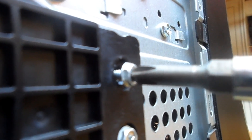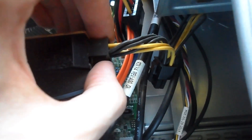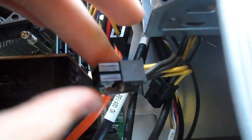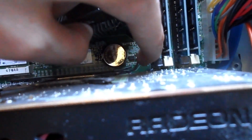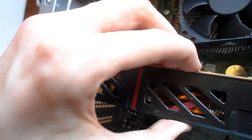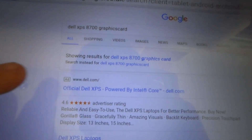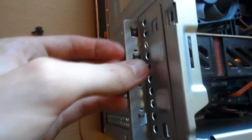Firstly, there was a little support holding the graphics card in place, so I needed to unscrew that and take that off. Then on the back, the graphics card was also held in place by a grate, so I needed to unscrew that as well. Next, I just needed to unplug the graphics card from the power supply, which proved to be a lot more difficult than I thought. Then I just needed to reach down, pull the little clip at the bottom, and pull the graphics card out. No matter how hard I tried, I could not seem to pry the graphics card loose. I even went as far as to Google it, but it turns out I just completely forgot to take the grate off the back.